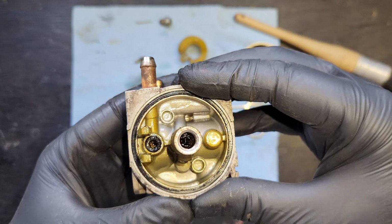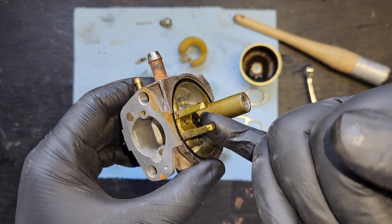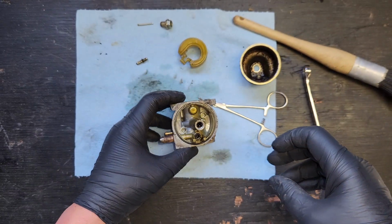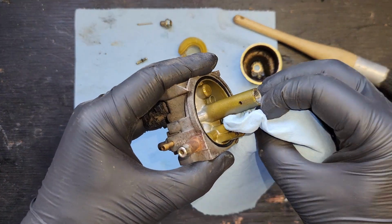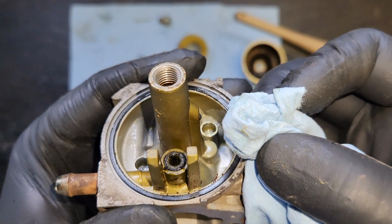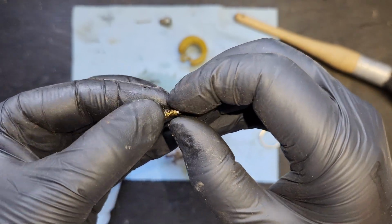The sealing occurs between the bottom of the seat and the needle. Why would there be this around here? This rubber, what appears to be some type of rubber. I could be wrong. I have been wrong before. I know it's hard to believe, but I'm funny. I know it. No, I don't think that's rubber. I think that's debris. A little bit of debris. Yeah, it's crumbling like it's almost rust.